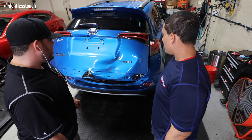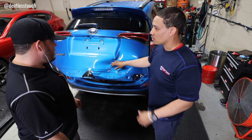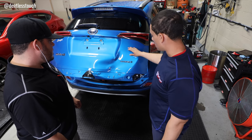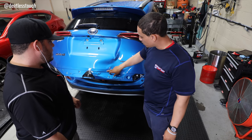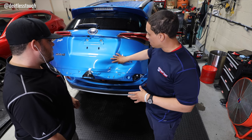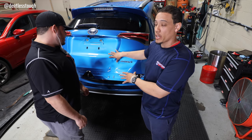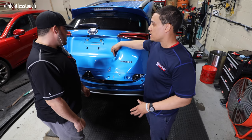Okay. That's what I'm worried about: pulling this up, and then this just gets all distorted and almost never looks right. So I will have to just watch myself. I would say this is the only crown, and this crown will probably be the only one that would prevent everything from moving up. You do have this area right here, that body line, which keeps the rigidity of the panel. So you have to watch that area, and it is low right in the dead center of that.